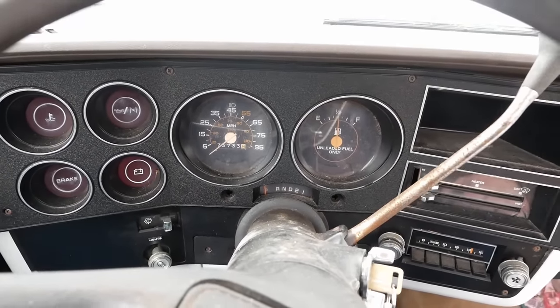I guess we could measure it, but it's probably 20 to 30 thousandths. It looks like it's around 20 thousandths, depending on how you wiggle it, but that's way too much. I guess the primary problem would be the vacuum leaks around the throttle shaft, but it seems like it's just getting itself kind of wedged against the high idle cam, and that's why it's not repeatable. Or maybe it's getting wedged against the idle stop. I don't know. Something's not right.